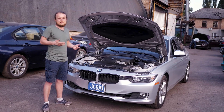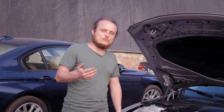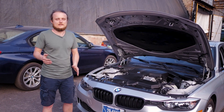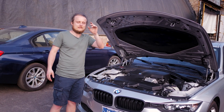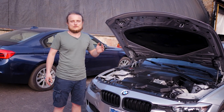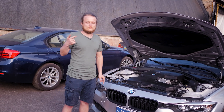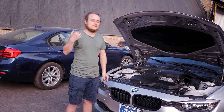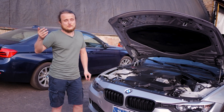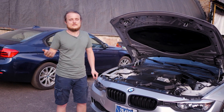For the most part, customers drive and everything is normal — nothing breaks down. From the main internal problems, the crankshaft can seize, but from what we saw, it happened when the engine came to our BMW service with one liter of oil, or half a liter, or two liters. There was also an American 328 that consumed almost a liter per 100 kilometers, so the gauge showed a low level all the time, and in fact it really was low — everyone thought the gauge was glitchy.